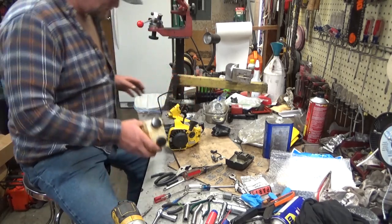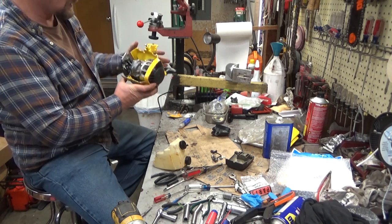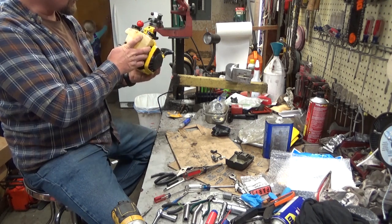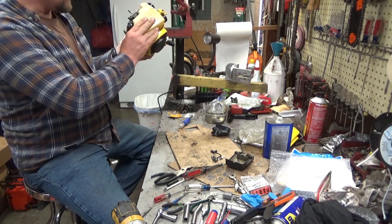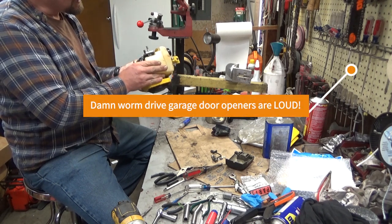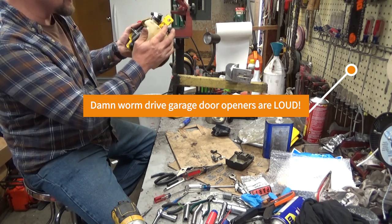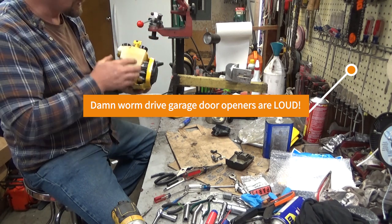So it's really important that you have that barb in place down here. And what you're going to do is make sure that your oil hose is pointed straight forward and start to index this in. You should feel it indexing on the fuel barb, and you should be able to see the hose going into the tank. And then you're going to go and snap it in. So there you go.